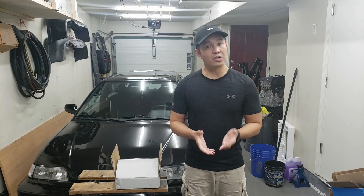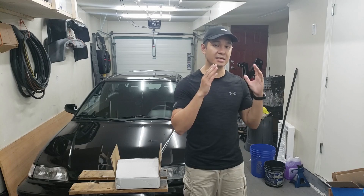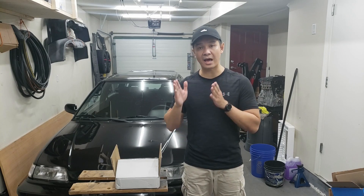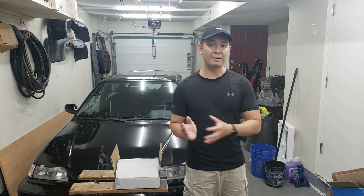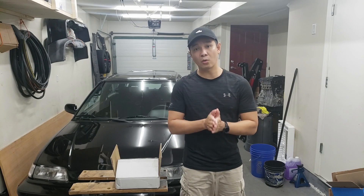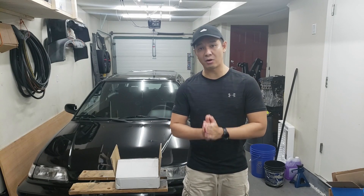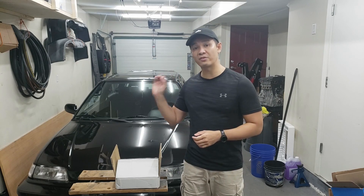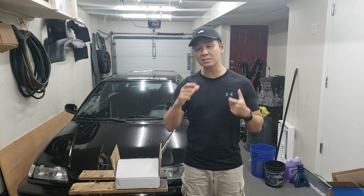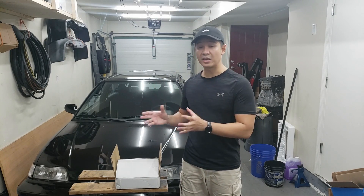These are probably very good quality and they look really good, but they're very expensive. Even the most budget version of their harnesses costs as much as an engine swap would cost, just to give you a little perspective. What's cool about their harnesses is that every single one of these vendors shares the same design - the harnesses all go to ECU plugs and then there's an individual miscellaneous plug. That miscellaneous plug plugs to another harness you have to buy, which is a chassis-specific harness. For example, my EF will need an EF-specific harness. That plugs into the miscellaneous plug, the other end goes to plugs in your car, and that gets the harness working with your engine and car.